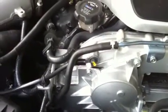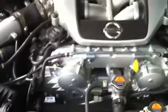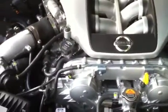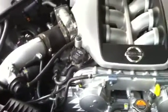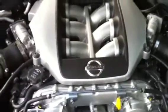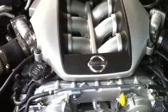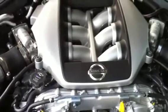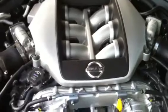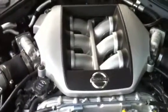a turbo engine you've got a big turbo that's sitting in your exhaust blocking it, and that creates exhaust pressure, exhaust manifold pressure. That's what drives the turbine. Now that is in some ways a bad thing, because at high revs, as you're starting to make the most out of your turbo and reaching its flow limits, that exhaust manifold pressure is usually higher than the pressure in the inlet manifold. Okay, when that happens and you've got valve overlap, exhaust gas can go the wrong way, and that means that your cylinders don't empty, and that's bad because you're getting less airflow through the engine, less efficiency, and also the end gases after combustion are not nice things to try and reignite, and the engine tends to detonate. So that's one of the reasons why just adding boost forever is not a good idea.